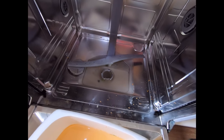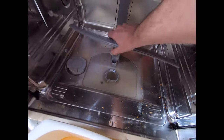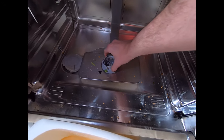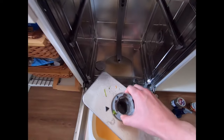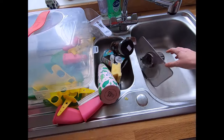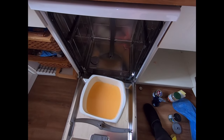I've got most of the water out of the dishwasher itself. I'm just going to lift up this spray arm, pop it out the way, and then I can actually access the filter itself which is just going to lift up from here. I'm going to pop this straight into the sink and just rinse it off, give it a clean just in case there's any debris in there, and then I'll get down into the water pump and impeller in a second.